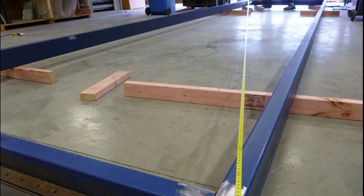Level is one important factor. The second very important factor is ensuring your frame is square. To do this we ran a tape measure diagonally from one corner across to the other — which required two people — then switched over and did the adjacent corners. We found that banging the trailer by tapping it was the best approach to nudge things, as we're only talking a few millimetres. We were able to get the trailer within plus or minus one millimetre.